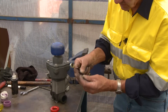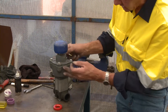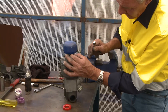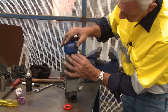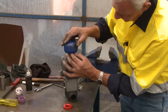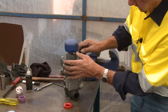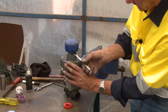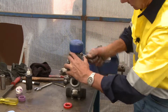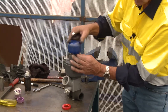If you wish to, give it a wash, blow it back out, put it back in. No need for thread tape — it's brass going into cast aluminium, so it'll find its own seat and the thread will settle down in there anyway. It'll tighten up to the stage where it's nipped. There's no need to over-tighten because you can actually stretch the brass and won't get it back out. And that's plenty. Do the same with the other one — repeat the step on the other side because there are two breathers, one for each exhaust port.